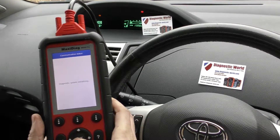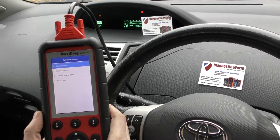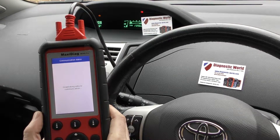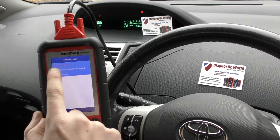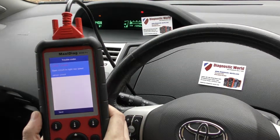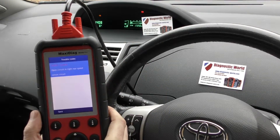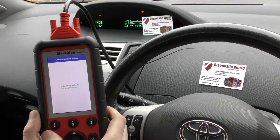Just a quick message about the system, and again this might take another 15 seconds. Here we go — read codes. And we've got a C1332 open circuit, rear right speed sensor circuit. So it's as we suspected because we put a new rear right ABS sensor in there. We haven't yet cleared the codes and the light is still on, so we're going to do that now — we'll click on to erase codes.